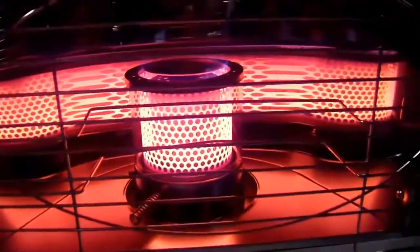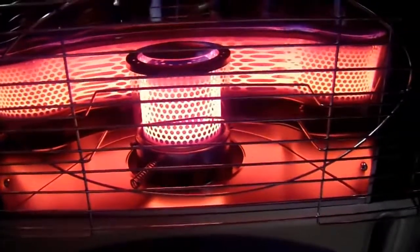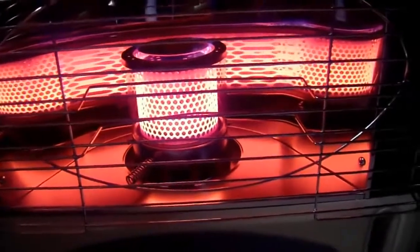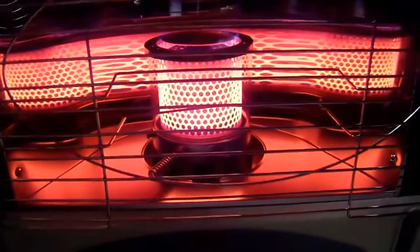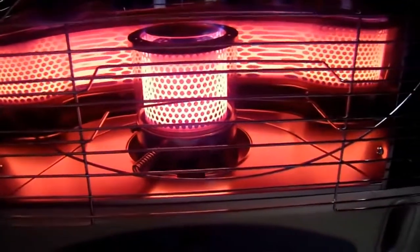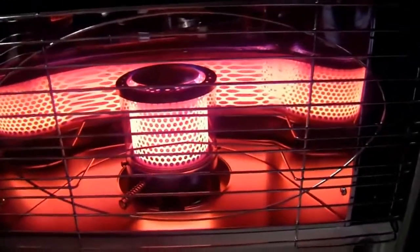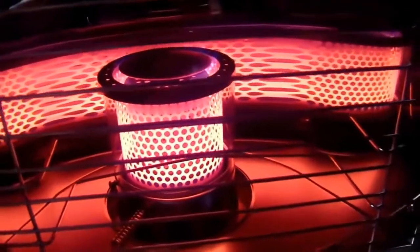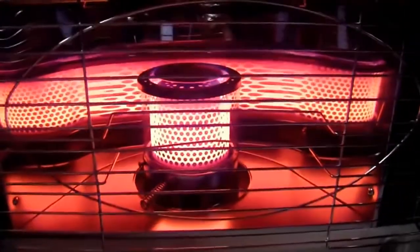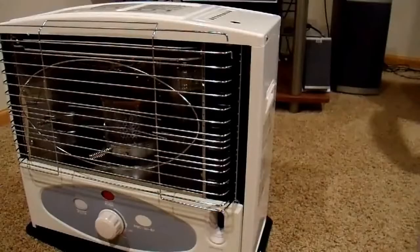It's too high. I wish I could turn it down a little bit more yet, but kerosene heaters are not adjustable. You don't want to turn the wick down and make them cooler. There's only one setting that they burn properly at, and that's the point of having this knob. I think they just locked it this way so that you can't turn it way down like some people would, and that's kind of a dangerous situation. To turn it down right before you go to bed or something, because you could end up with carbon monoxide poisoning then. But I wish it was a little bit more adjustable than this. I think if I leave it all the way down, it'll be acceptable. But I'll let this burn for a while more and bring it inside and light it in there and see how that works inside.